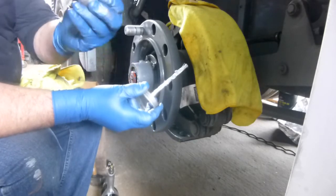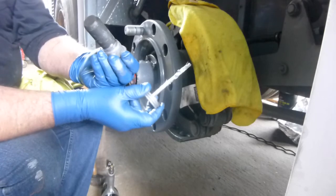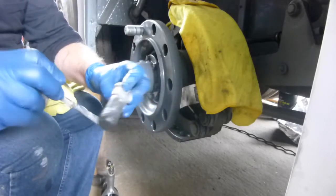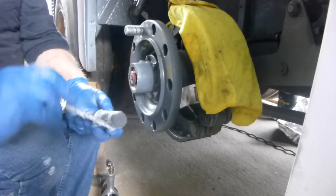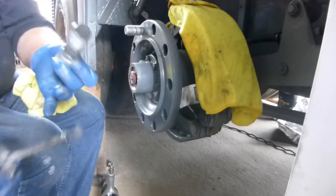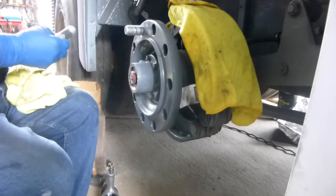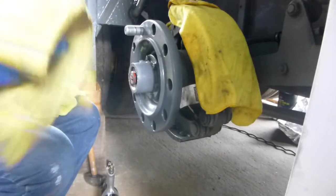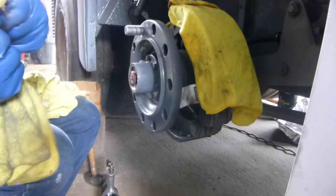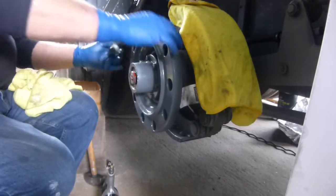I've got an 'R' marked on here for the right side - it's easy to put the wrong stud in if you don't keep them separated, and then you've got to take it all back out. I put compound on the thread area, about an inch, and by the time you're done assembling, the whole stud will be coated. I want these threads protected as a slipping agent. Then take an old rag and just wipe around the serrated area to get the bulk off - leave the threads completely alone.